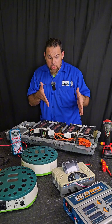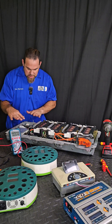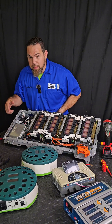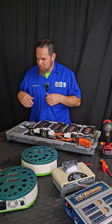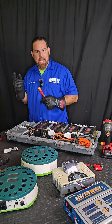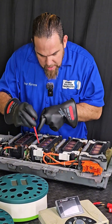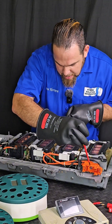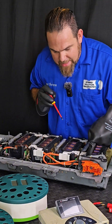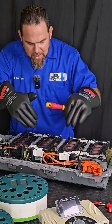The circuit is completely open, the service plug is out, and there is no residual voltage at the output. The battery management system and junction box cabling don't give easy access for direct connection. I can open the main positive outlet, but I need to find the main negative. Following the circuit — positive to negative, then back through the service plug bridge — I locate the main negative. However, it's not easily accessible without disassembling many components.